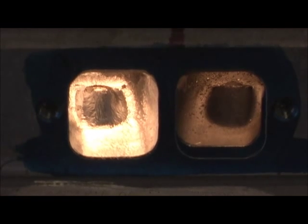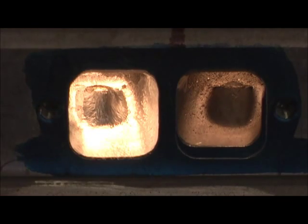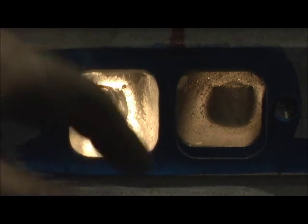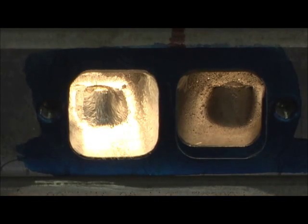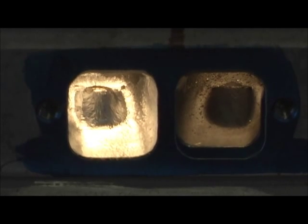You can just tell. That right there is it. There's some finessing I'm going to do with my little finger where I go in there and lightly touch the bottom — y'all have seen me do that a thousand times. I'm pretty much going to let this be it except on the bowl when I do the valve job. But this is pretty much what all the exhaust are going to get — raising the roof on it. We'll get back here when we get a bunch more of these done on the other three cylinder heads and the pair I've got right here to finish up raising the roof and doing the guide thing. That's all for right now. See you later.